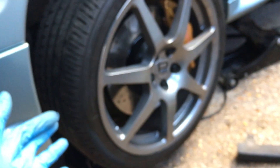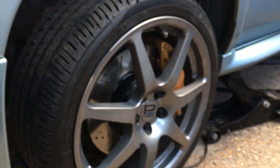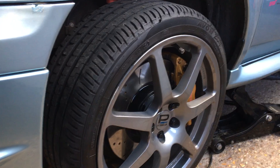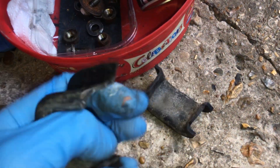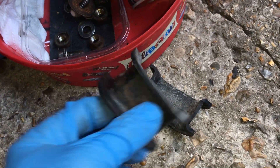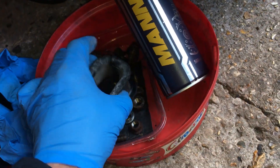It's a PowerFlex unit — 30mm for this car — that should reduce the tiny bit of play I've been having on the steering. It could also be the worn steering system, but the tie rods are new and tire pressures are all good. The existing bushes are hard and quite deteriorated, so having new polyurethane PowerFlex bushes in there will definitely help tighten it up.